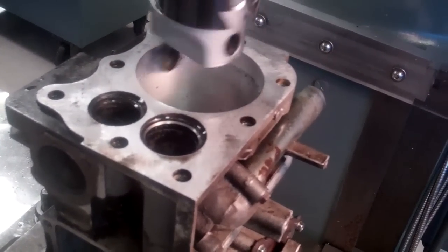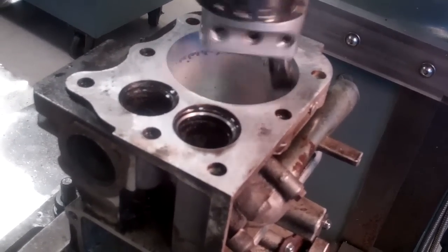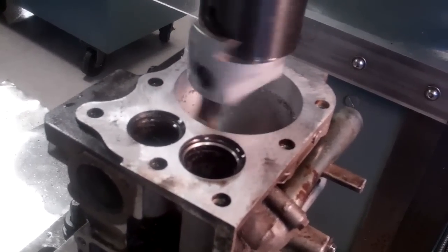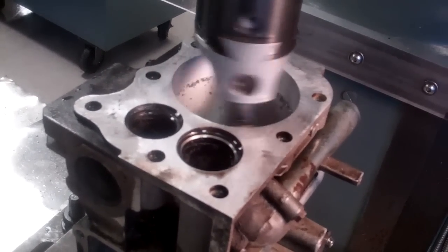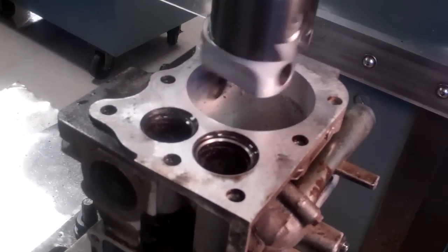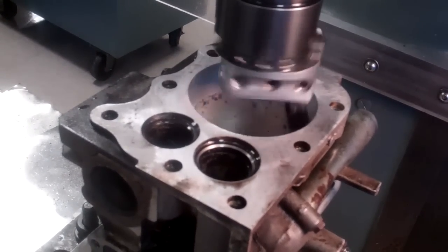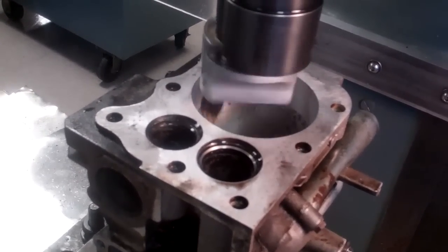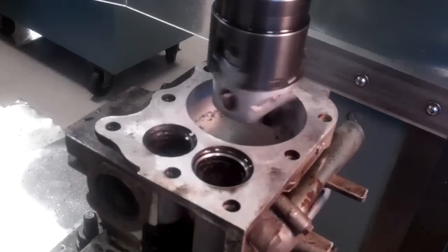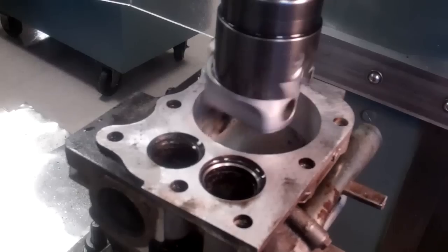All I'll have to do is take the block, clean it good in a soapy water solution, blow it out, and put a nice chamfer on the top of the bore so I don't damage the rings installing them, then put the thing back together. For honing, I have a nice cylinder hone — not one of those dingleberry ones, but a proper stone hone that I use all the time — so I'll use that and get my crosshatch pattern. I'm going to have to call this thing a success. Once I get it assembled I'll do a cold start so you can see a good success — or you can all write in and laugh at me. But I think it's going to be a success.